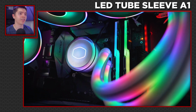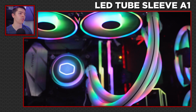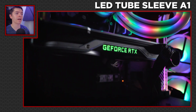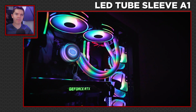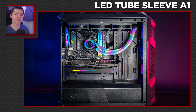And last for the case accessory kind of thing is the LED Tube Sleeve A1. It's a sleeve that goes over, say, your AIO cables. They've provided a lot of images of how you could use it, and it's just a way to ARGBify your dull AIO cables, if that's something you want to do. It comes in 10 and 12mm variants. It's made of soft rubber, and it has 30 ARGB LEDs in each tube sleeve. It's 330mm long, and it's a 5-volt 3-pin ARGB, so I think that's your JRainbow connector, and it has a 2-year warranty. So it looks interesting. I'd like to see what that looks like in person. I wouldn't jump out and buy that before seeing some reviews personally.